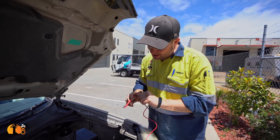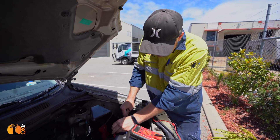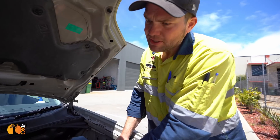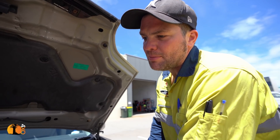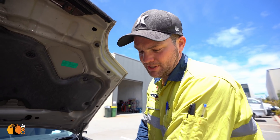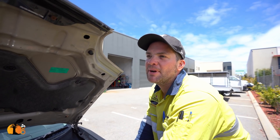If it's an old-style alternator we should have 14 volts on it. The engine is still warm so the alternator would have reduced its charge voltage — and that means we can use a smart solenoid or even a direct connection to charge the battery up, not in a perfect manner but in a good enough budget way.